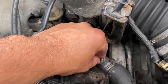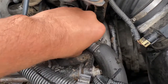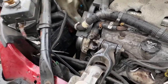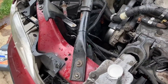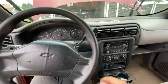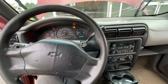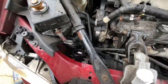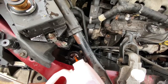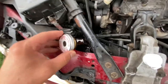If the fluid wasn't coming out of the bleeders, you could use a small funnel and pour directly into those holes — but that's basically the trick to bleeding this system. We have them just finger tight for now because we'll undo them again. We top up the reservoir all the way, then go inside and start the car up. As soon as it started, all the antifreeze level dropped, so we top it up again until it's full.